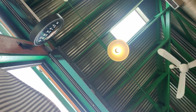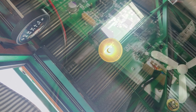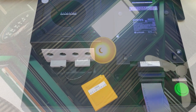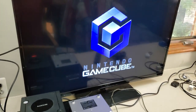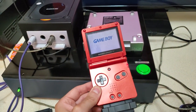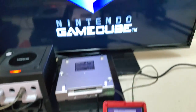As I waited for my new Game Boy Player to arrive, I began thinking more and more about this. Why would a Japanese Game Boy Player even work? The problem is the only thing connecting the GameCube to the upside-down Game Boy Player is a memory card on a cord — that's literally the only thing going to the board inside. How would a GameCube know to make that connection? It's got to be a software thing. There needs to be some piece of software that will allow the GameCube to make the handshake with the board and therefore the upside-down GameCube and Game Boy Player.